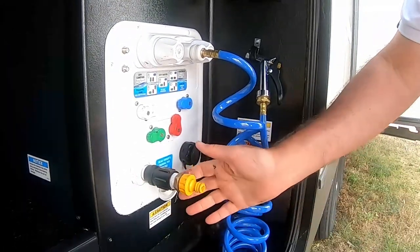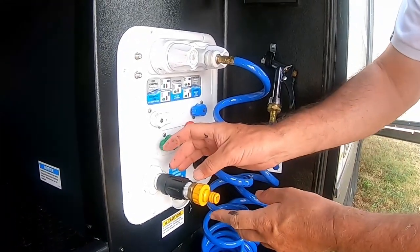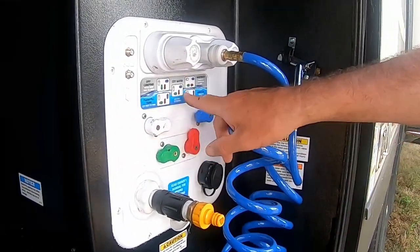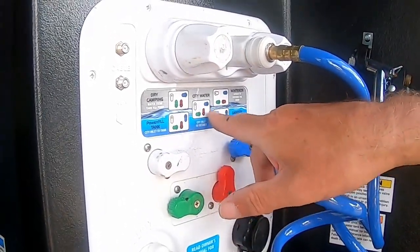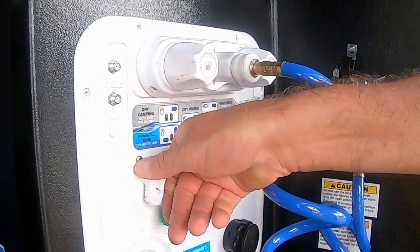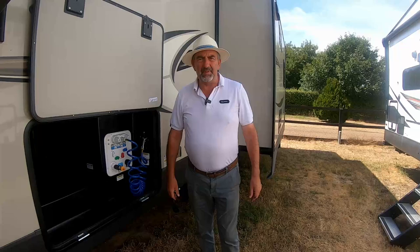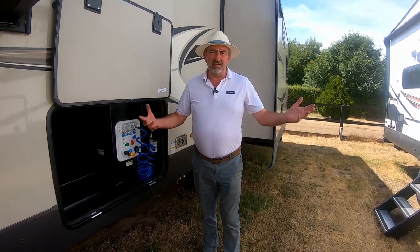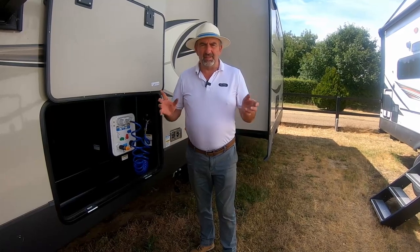Once she's tight, you get the hose lock fitting from the water point and clip it on — that's your pressure reducer, happy days. Then you put the knobs in the right configuration for city water. Turn the white one down to the city water position, and that's your city water hookup done. You really do have to use these on any American RVs, travel trailers, or motorhomes, because you run the risk of blowing fittings off inside the van.